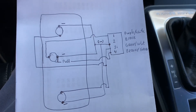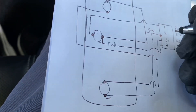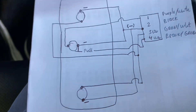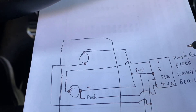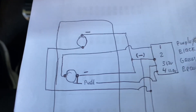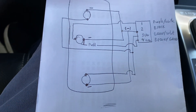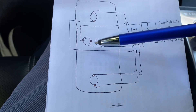So basically that is the schematic. What I found: when the car is open or engine is on, terminal 3 has 12 volts, and terminal 4 constantly has about 11.7 volts all the time. This block is the minus, and this purple-white is not sure but also looks like minus — I was calling between the contacts and it's for sure not plus. That tells us the center button probably has some additional components on its chain because of the dimmer effect, and I don't want to mess with the center one.